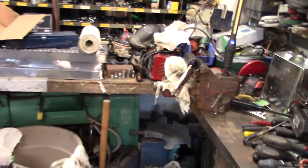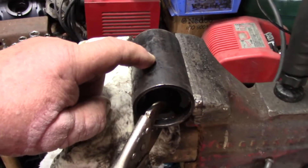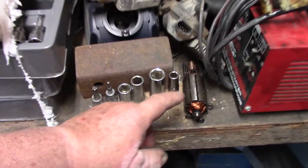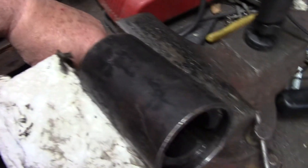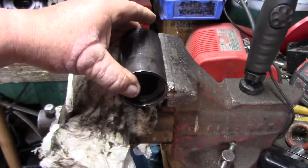Painted this yesterday, turned out not bad — a little bit of dust on it. I'm in the midst of something else too. I'm rebuilding the magnet on the little motor that drives the pump that raises my outboard engine — the tilt motor. It didn't want to go. See this, the armature — I re-glued the magnet, it was broken right here. I'm gonna sand that down and lap it a little bit, make sure she's clear.